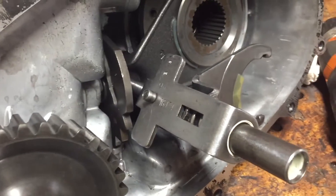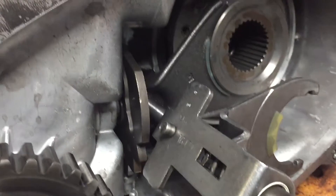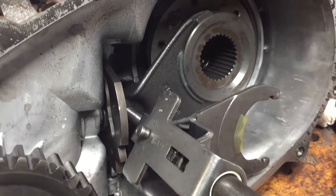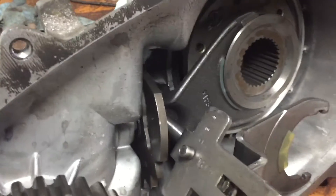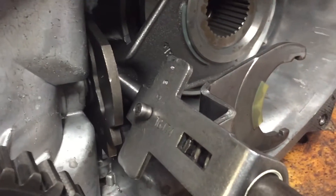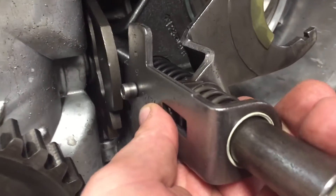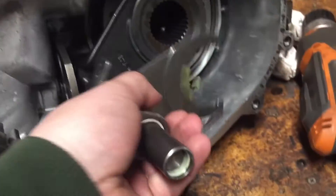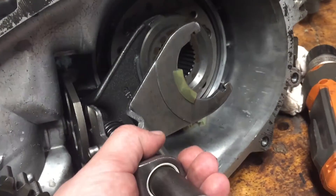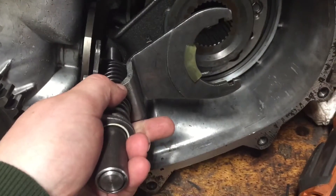If you shift it all the way to this position where your pin is in there and your roller, you can kind of pry it out and the whole thing comes out. It's probably not the recommended way to do this — actually, I'm going to say it's 100% not the recommended way — but it's the way I had to do it; I ran out of options. I've read a lot of other people on XJ and ZJ forums that ended up destroying the case trying to get to it. It doesn't seem to have damaged anything; the plastic pieces are there and they're going to ride on your selectors, so I'm not too worried about it.